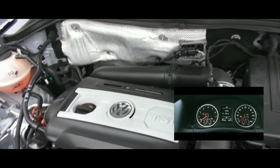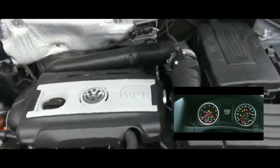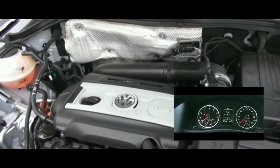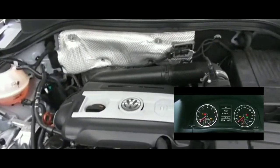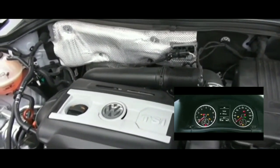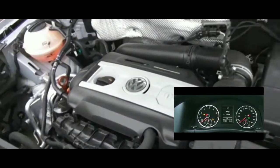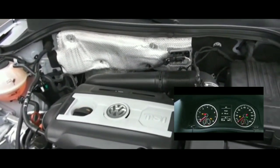Considering it's overcast and drizzling out, the headlights were pretty bright, so I assumed it wasn't the battery. But I can't be 100% sure. With headlights that bright I should be getting at least a slow crank, but all I heard was a click — I must have tried like 15 times and only got a click.